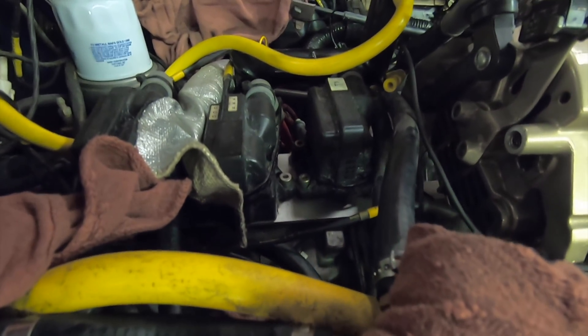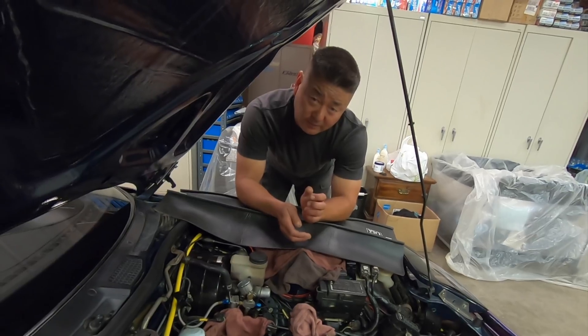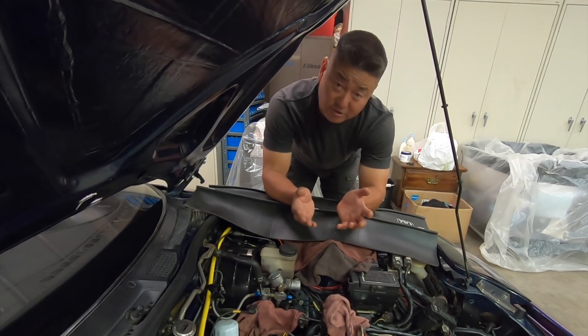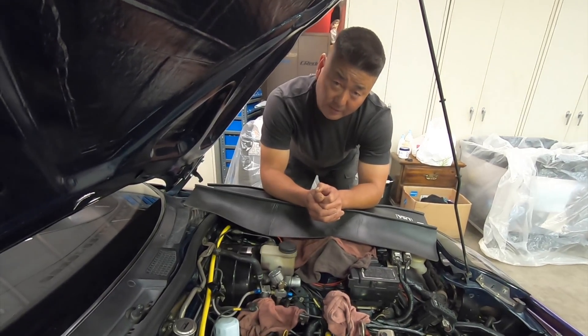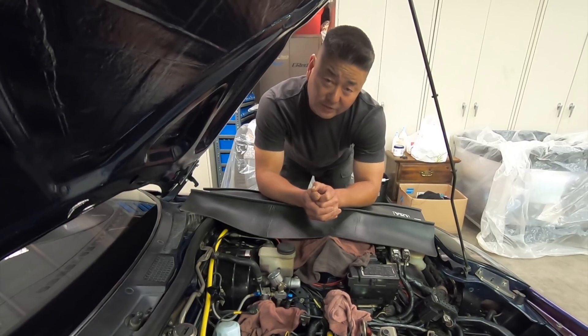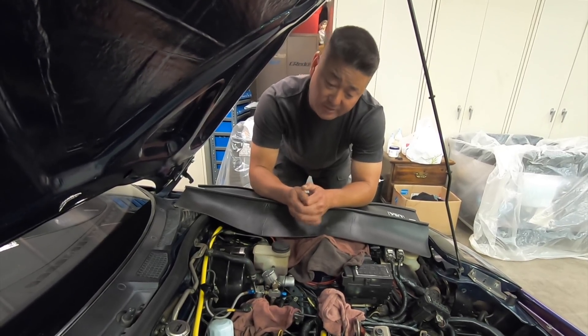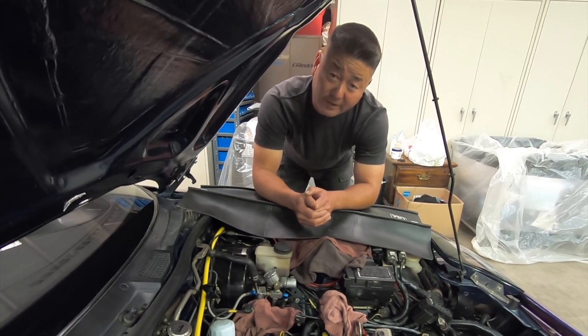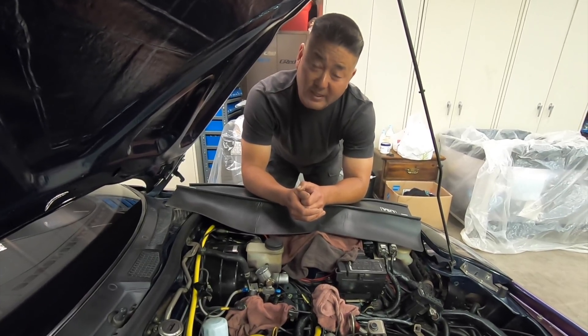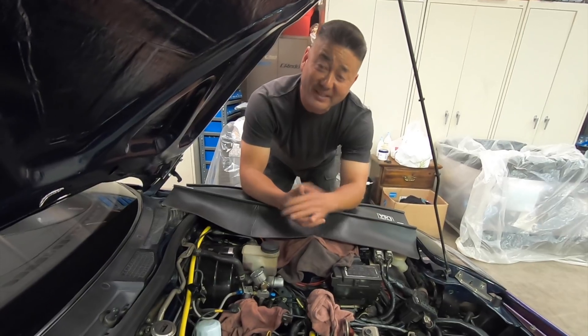I have three tips that could possibly help you. The first was taught to me from JC and has worked out on many different cars that had a misfire, especially at high RPM. This works best on the dyno because of combustion chamber pressure and resistance, but it'll also work on a free rev when it gets bad enough. If you run the car up to high RPM with the lights out, you'll be amazed at what you can see — as clear as day. If the coils are giving way you'll see everything light up. It looks like lightning, because where the case gives way, the spark will jump to the path of least resistance to the nearest grounding point and that will tell you if you have an issue. It's worked on tons of cars, not only the 7 — on the NSX too. It's something that might work for you.